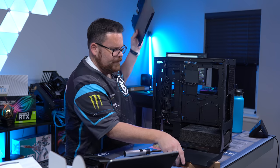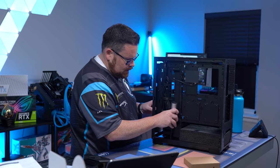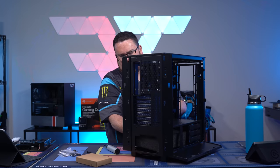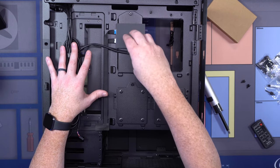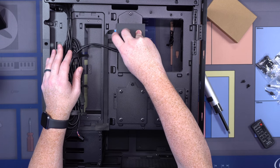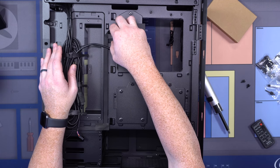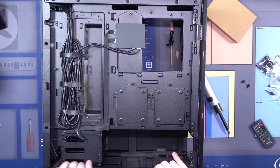Okay, there we go. Now, the last thing I want to do is we're just going to quickly undo this real quick. And we're just going to move this forward. Okay, now you can get the brick out. You do have the covers that go over everything so you can hide all your stuff. This is your Chroma module. This thing uses super thin ribbon cable. So when you are building, make sure that you take extra care here in terms of not breaking this, because then you'll basically break your underglow support and stuff like that.